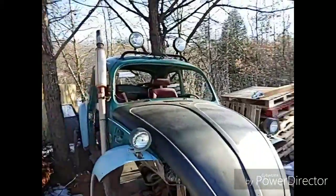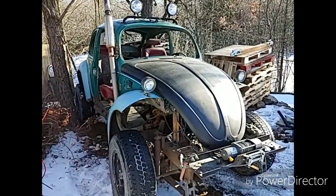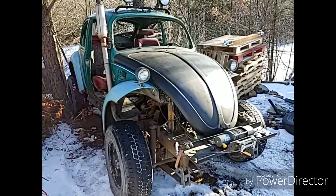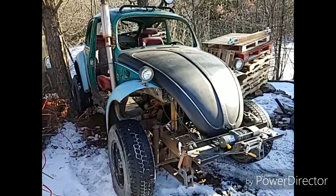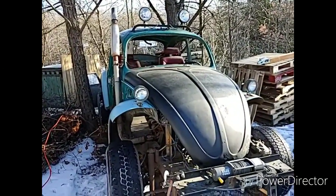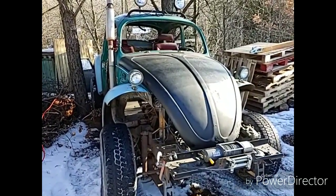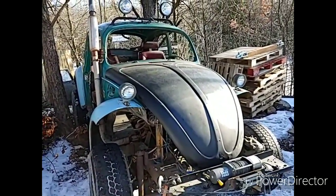And then I remembered what a lot of people do in old cold start videos, whatever you want to call them. They jump a wire from the battery positive to the ignition coil positive and start it that way. And I had done that and jumped the starter solenoid, which is right there, and it fired right up, which is freaking weird. And I pulled the wire off because I just wanted to see if it would start, and it just kept running.